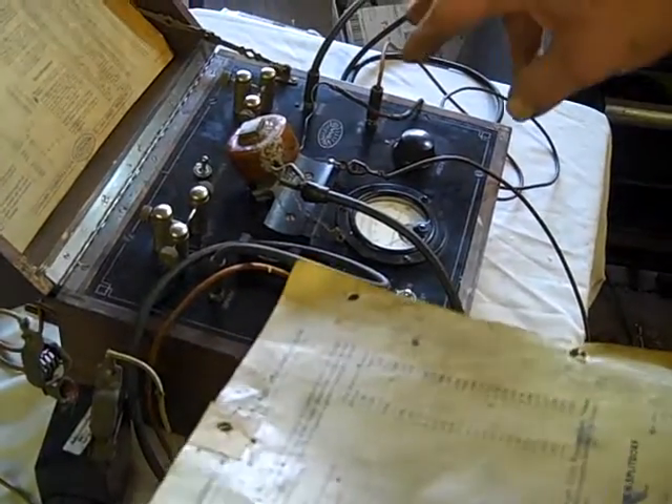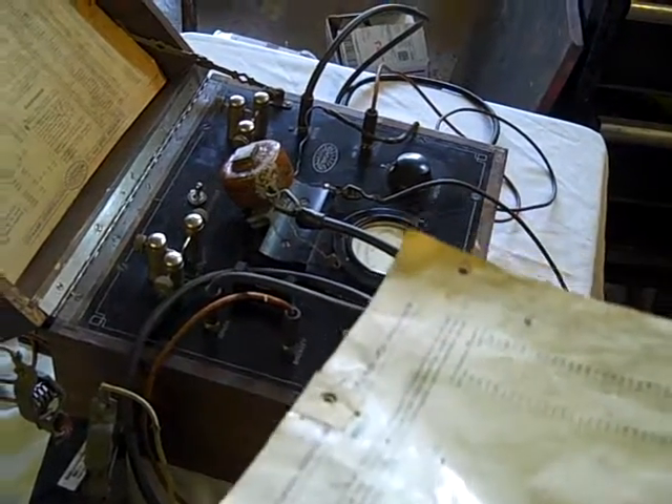When you open it up, we can pick out one here where it says WICO. You'll see the amperage as the core is reading. The most amperage this will handle — only because of these types of coils — is actually from about one and a half to about three amps. The voltage we're introducing here is a DC six volts, but that's only for testing. The actuality of these coils when they're being used is really produced through the coil magnet's flux, which is probably about four volts. You can scan through and see American Bosch and the listings of what coils are being tested, with the maximum amperage — like 1.35 — going all the way up to three, or 2.95.